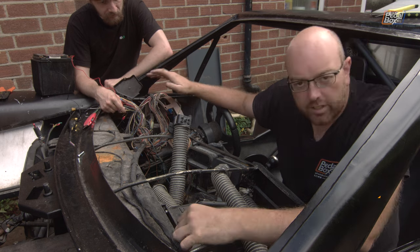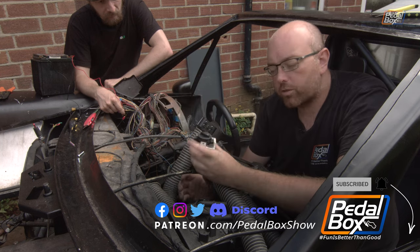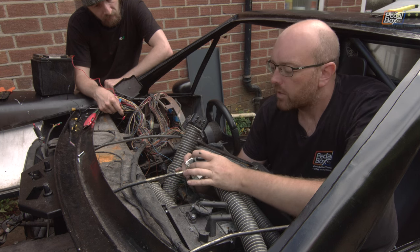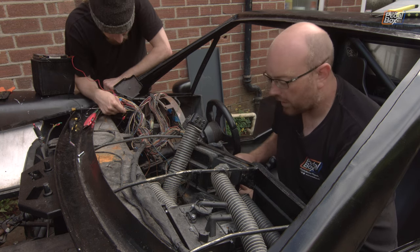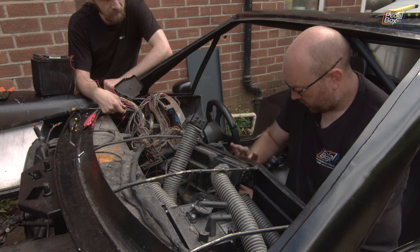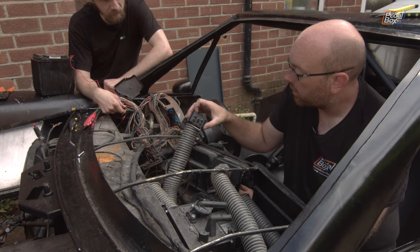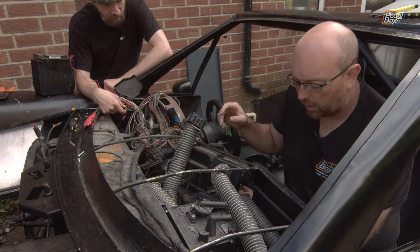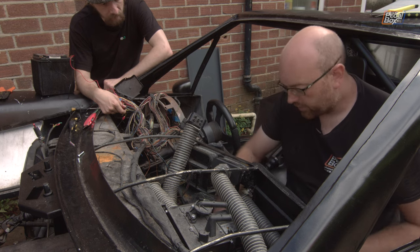While we've been working in the fuse box, we decided to run the power that our heater box needs. So we ran a new power line which runs down into our control switch. We've got three wires coming out the back connected to two, three and four - we don't have four modes, so we've gone with zero, two, three and four. They run down into the heater box. In theory, if Chris puts power into the fuse box now and I put it on two, it should work. And if I open up that vent, that blows nicely. They're all working quite nicely, and the butterfly valve actually seals reasonably well - it will still help direct more of the air to other locations. Medium and high both work, which is very, very pleasing.